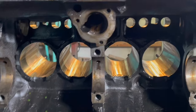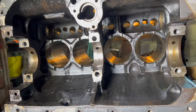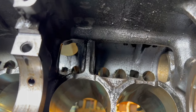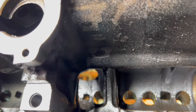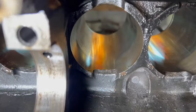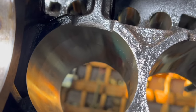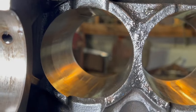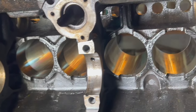Here is what the block is looking like. The biggest question from everyone and from myself is: is the block cracked, is it going to be able to be saved, what is the true damage? Now we can finally get in here. Up here there is clearly some hitting, some damage — I don't know how severe that is. This is where the third cylinder was. There is some damage, and a few people were asking if my cylinders were sleeves — it doesn't look like it. So if the engine isn't cracked, I want to know if I'm going to be able to re-bore these and if it's going to affect engine performance or reliability. Let me know if you guys see anything alarming — I will be taking this into a machine shop.